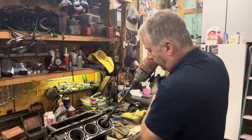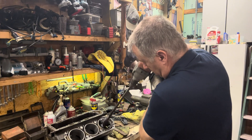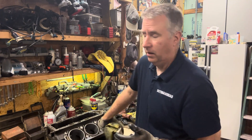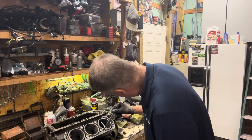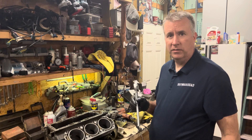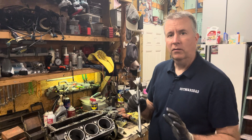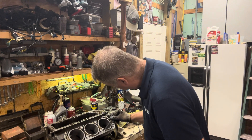I'm just going to do a little bit more, then measure and see where we're at. You'll get a nice slurry going when you do this, and you'll feel it really start to cut and have a nice machined effect to it. In that first pass, we took out about just about a half thousandth — between a half and a quarter thousandth. It's not going to take out as much this time because we've knocked off all the high points from the really deep scratches from the 100. We're going to go a little further. I want to get right to that four and a half to five thousandths range on all of these, still measuring down the bottom, halfway — should be pretty straight.